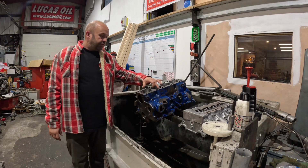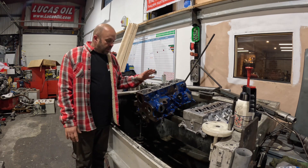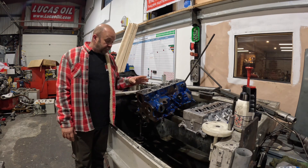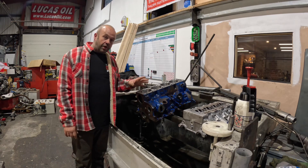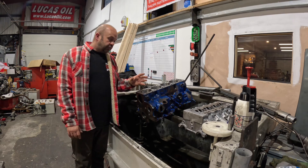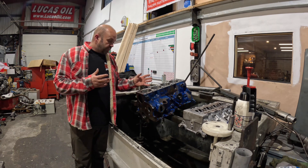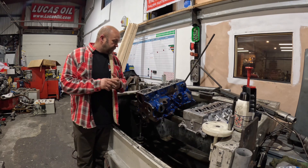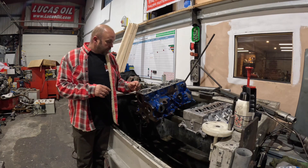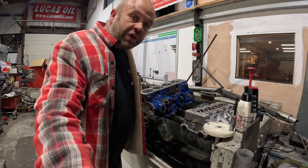So there's a block here that I haven't filmed actually machining, but I just thought I would mention it - it came in for a rebore to suit piston and a block re-face. And this is for the Eggenberger 1985 Steve Soper car, which is being restored by a friend of mine's company, AWS. I feel actually really privileged to be able to do this because it's a big part of motorsport history. So this is a Ford Lima block and we've bored it and re-faced it. So I'm really chuffed with that.